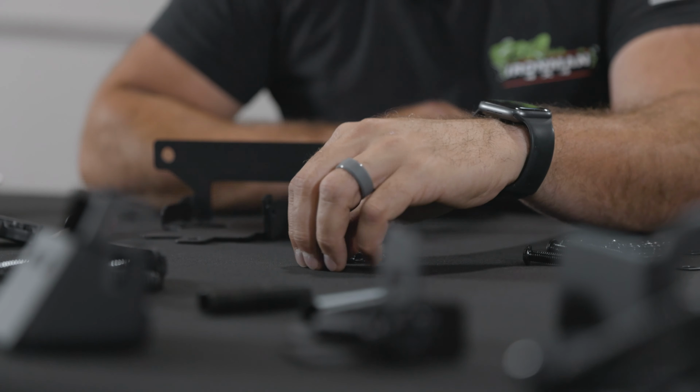There's 10 mil bolts, 1, 2, 3, and 4. I pulled those out already. I'll pull this one. Double check because you've got a wire harness over here on this side. That's free. Over here, make sure your washer sprayer and your fiber optic camera cable are unclipped from each other. And I think this just pulls right out. Pop this wire harness out just by pulling that little Christmas tree clip.